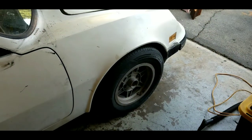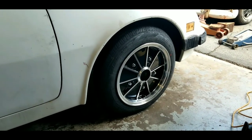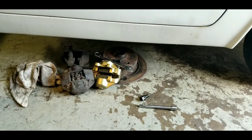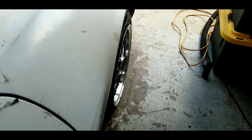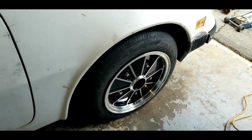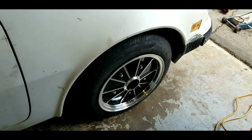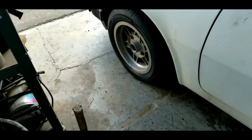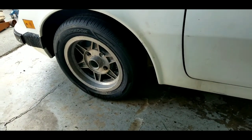Tomorrow I'll bleed and adjust the brakes, and we'll roll it out and take a better look at it. This is the five and a half inch BRM with a 135 tire on it, running disc brakes and wheel adapters — but the wheel adapters hit my calipers. So I'd have to space it out even further, and as you can see it's sitting out there considerably. Looks a little hokey in my eyes. With as much room as we have behind the tire, I think I can go with a four inch narrow beam if I'm going to run those tires. I'll end up going to a 185-60-14 for the front end of the Puma with a two and a half inch drop — and that looks pretty good, I like that. It takes up most of the wheel well and it's not too low. In the back we've got 195-75-14.